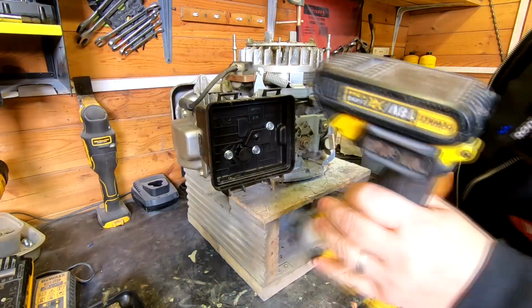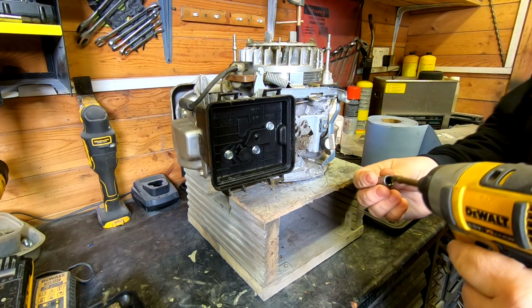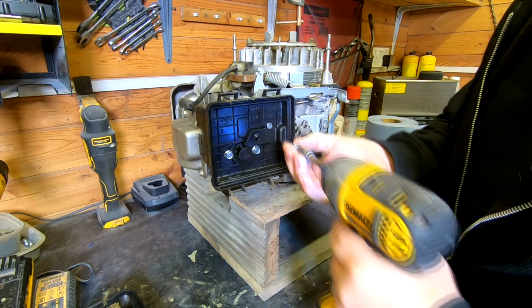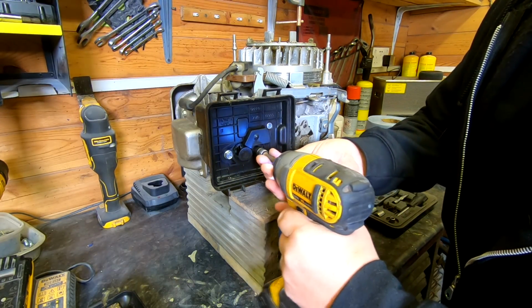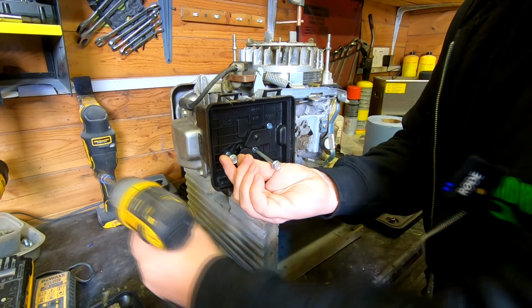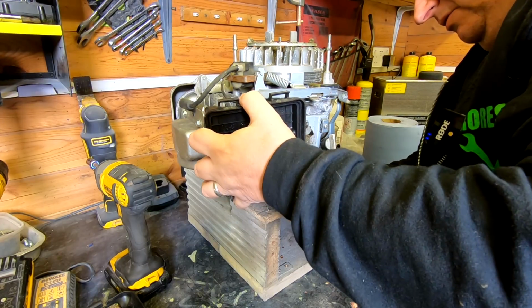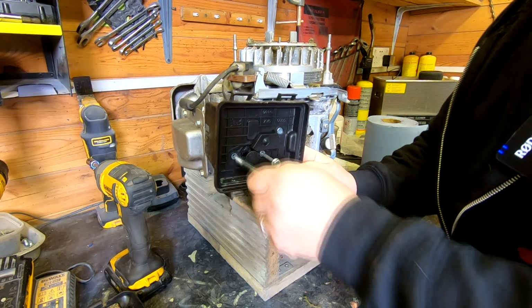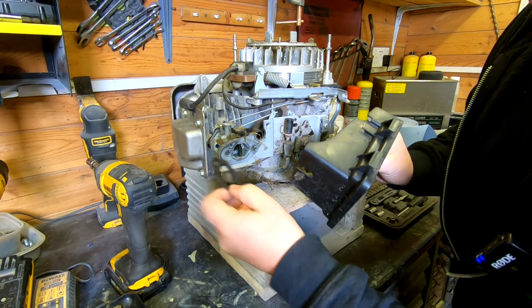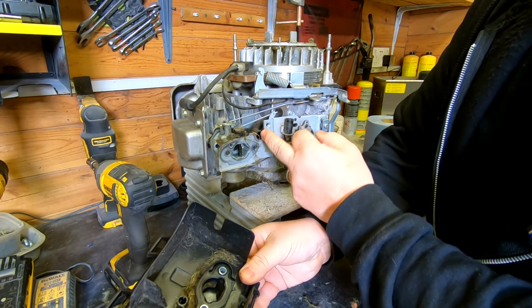So while we're here, I'll just get me quarter drive socket set out with a 10mm socket on it and just zip these out. There we go. Ease that forward, and there is a breather pipe on the back there, as we will note, which you have to dislodge. Let's take them out. There we go, and there is a gasket that just dropped down there. Again, make sure that that goes on that way. Keep that separate. So there's our air filter box, and on the back there, as you can see, there's that tube there, which connects up to that tube there.